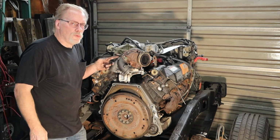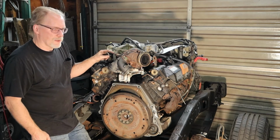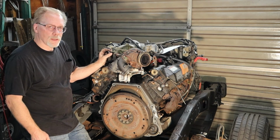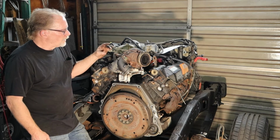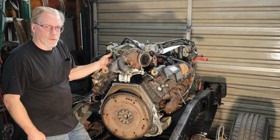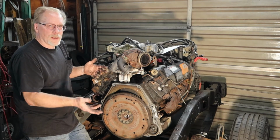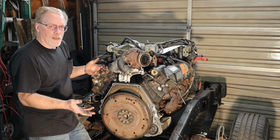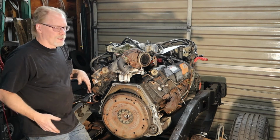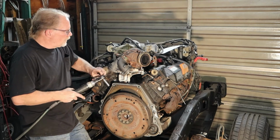Now before you remove this, go through and just take a visual on how much proud the threads were, because you'll clamp this back together unknowingly, not having it in the clamp properly. You'll get it all done, start it up, you won't have any turbo, and you'll go back in there and find out, oh, well, now I got to loosen up all the bolts, reposition this, put it back in place where it ought to be. So that's key number one. Make sure you do that.